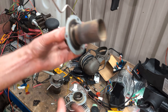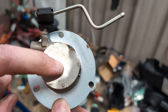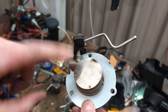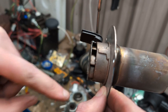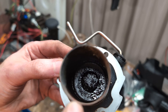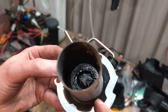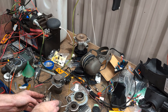So, standard 2kW burn chamber. You've got this panel at the back which is like three rivets peened over to hold this back plate on — that helps swirl the air through the burn chamber rather than just going straight in the end. That's the glow plug hole. There's a recess and a hole, like a ledge inside. This one's obviously full of waste oil sludge.